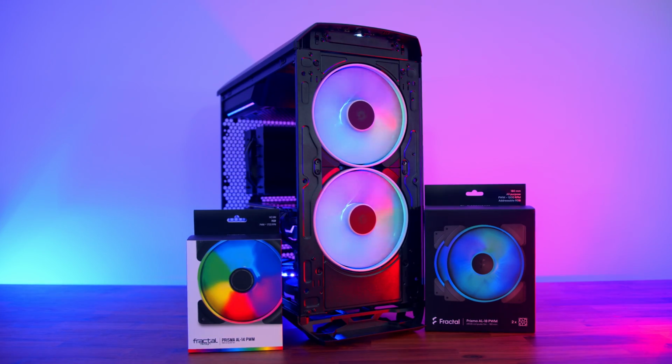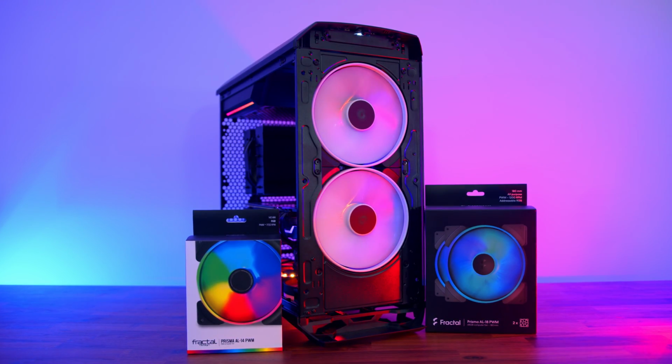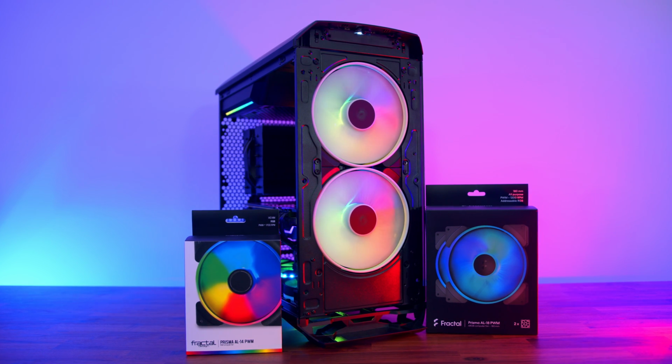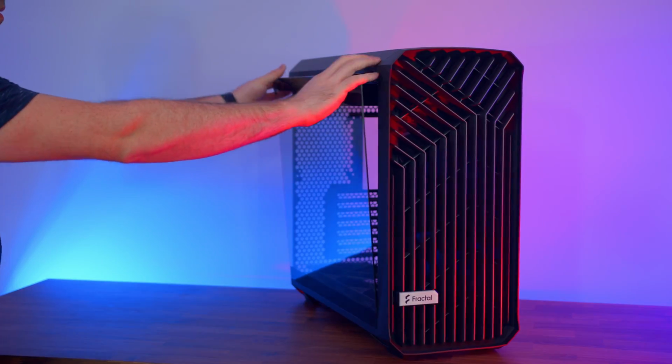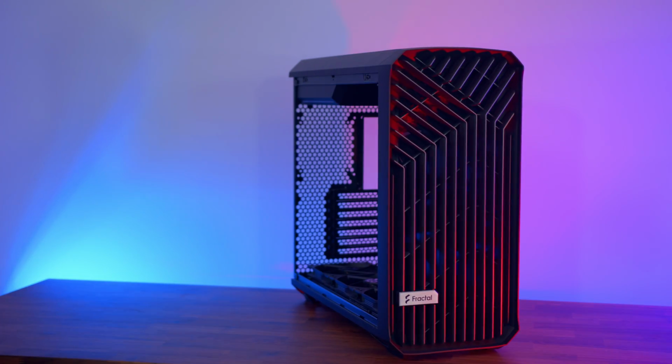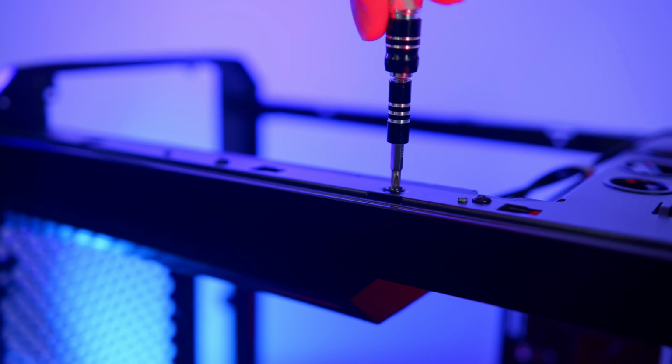No matter what version of case you go with, the 180mm fans will operate at a maximum 1200 RPM, while the 140mm fans operate at a maximum of 1700 RPM. The panels on both sides are tinted, though the one on the cable side is darker to hide any cable mess, and simply pulls towards you to remove from their latches. The panels can also be screwed down from the top if you're travelling with your system.